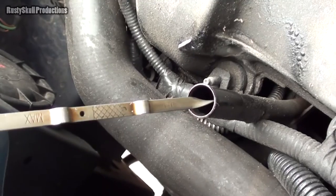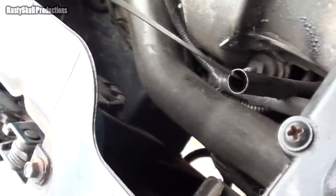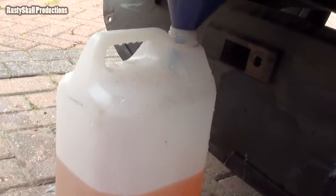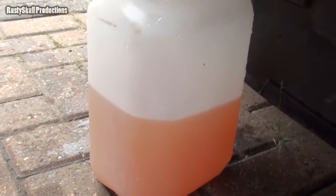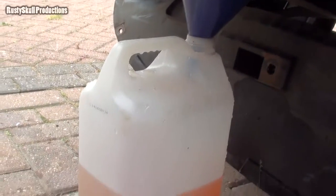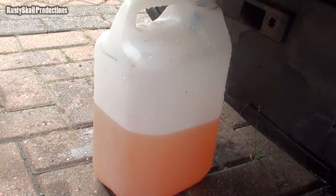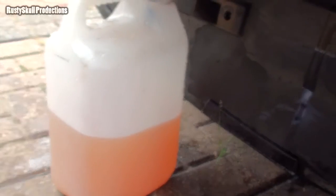It's got plenty of nice clean oil in it now. I always fill it up to the minimum mark first and then check it once it settles. Now I'm draining the coolant — it's only dribbling out now. I'm going to change the fuel filter while I wait, and because we're on a bit of a slant the water should come to the front of the radiator. It didn't overfill the 5-litre can. It doesn't look very nice though — it's orange. It shouldn't be orange; I've never seen orange coolant before. It smells bad as well — it's probably never been changed.